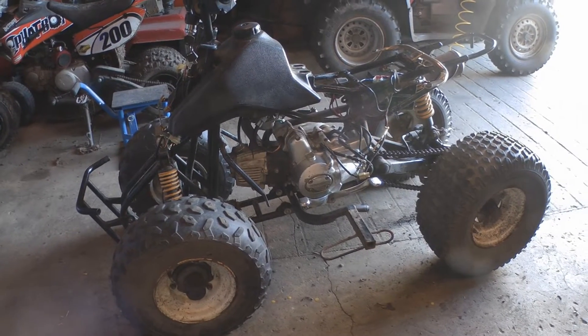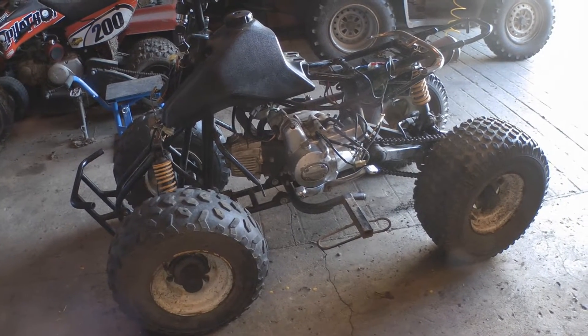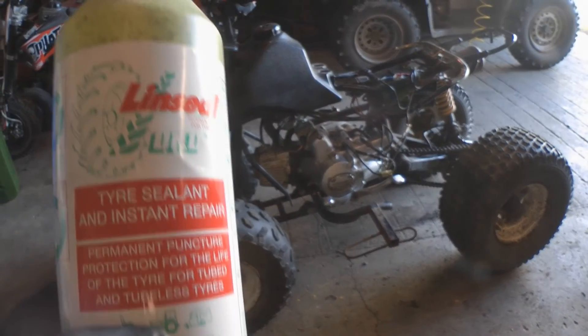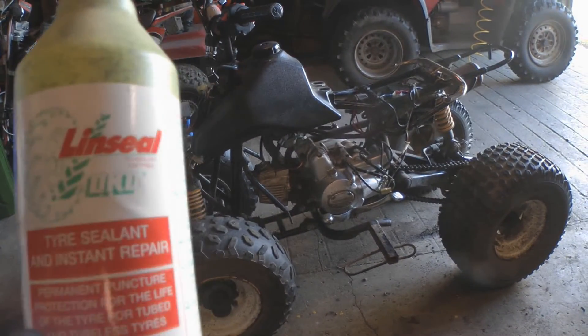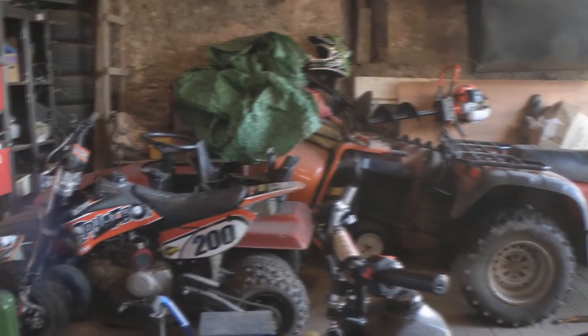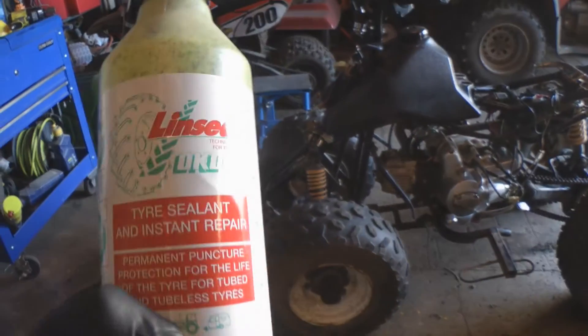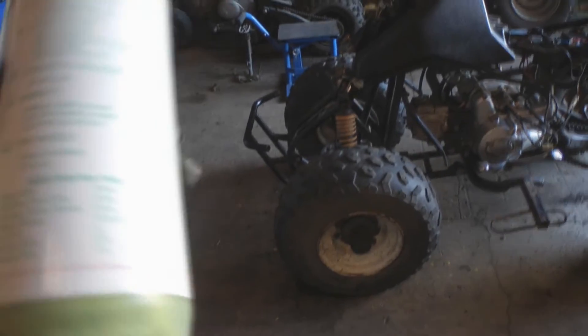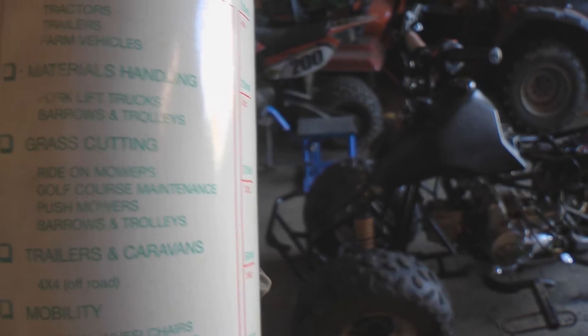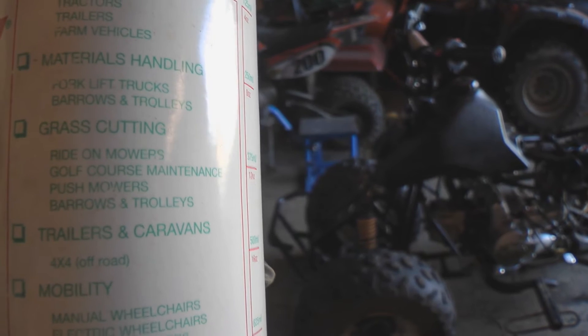The front end is mostly done. I'm going to deal with the fact that the tires keep losing pressure. I'm sticking some Linseal in — I swear by this stuff. I use it on the big bike, the lawn tractor, wheelbarrows, and sack trucks. It really does what it's supposed to do — it seals existing punctures and any fresh punctures from nails or anything like that.